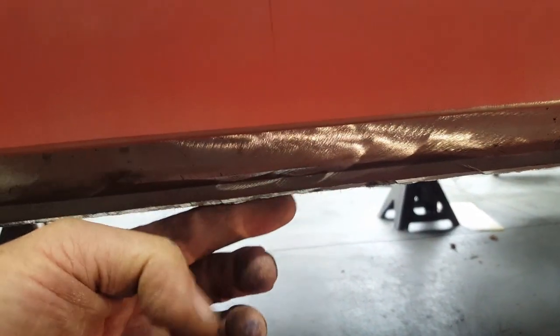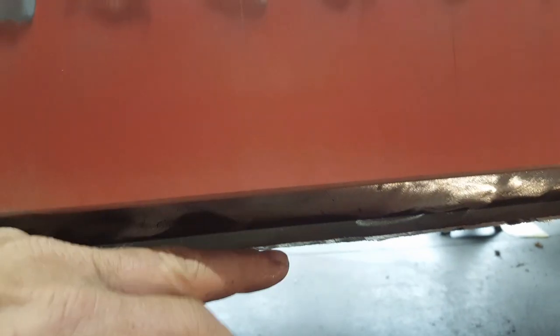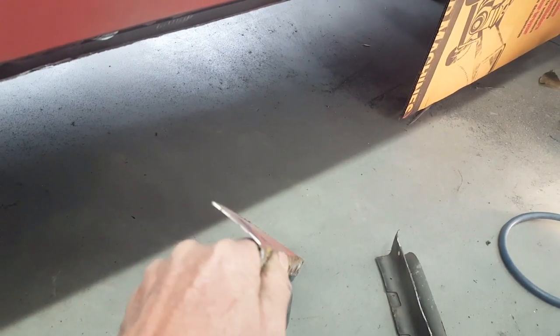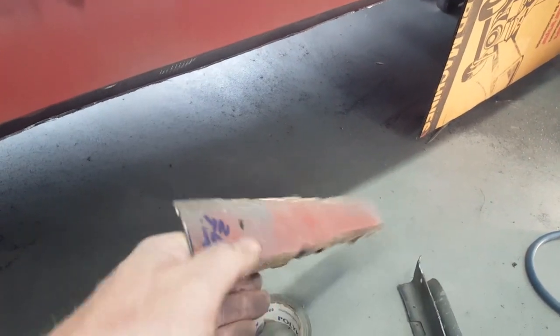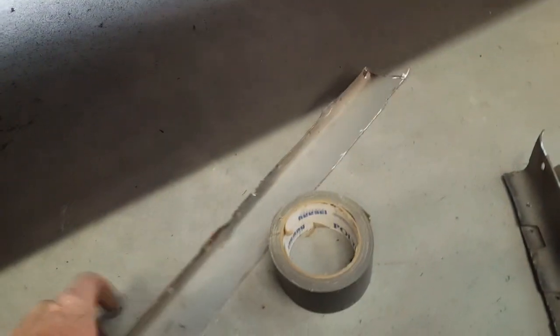Down on the floor - not a lot of fun. You can see there's still material left. The back wall of the pinch weld is still there, about three-eighths to a half an inch still hanging down, which makes it about an inch and an eighth from here to here. I'll have to come back and fill that in all the way along to the back of the car. All I did was eliminate this piece, which since I'm not connecting to it, there's no strength there.